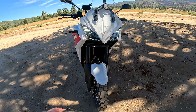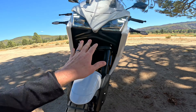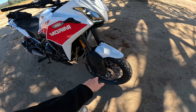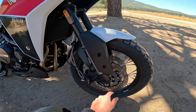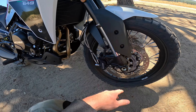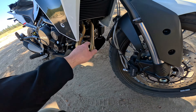Let's be honest — with that limited travel, it's really not an off-road bike. It can do some light off-road, but it's really not like a T7, KTM 890, or Touareg. It's more of a road-going adventure bike. The rear shock has only 140 millimeters or 5.6 inches of travel. You have a rebound adjustment and a preload collar, but I don't think you're going to be able to adjust that preload without taking the shock out of the motorcycle.